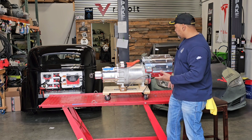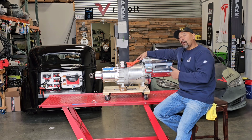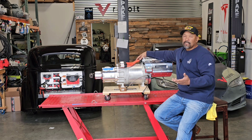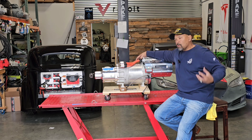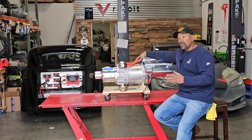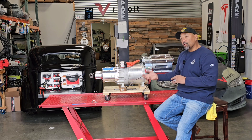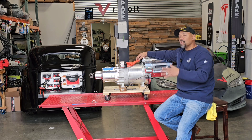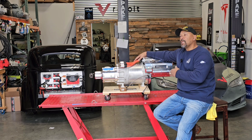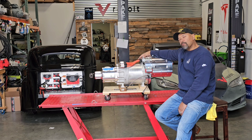That's a brief example of what the Revolt CR43 Bravo does. Another huge benefit of using a Revolt kit is you don't have to cut the car all to pieces to substitute the motor. If you took a '65 Mustang — most of you guys are familiar with the doc — we pulled out the old 302/289 and put in this Revolt crate motor. A typical EV conversion usually puts the motor in the back, so you have to cut the subframe out and put a rear subframe in to make the motor fit. This is almost a direct replacement, just like swapping a big block or a 302 to a 350. That makes it really easy to convert a classic muscle car to EV. So this is a breakdown of the Revolt 43 Bravo.